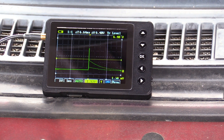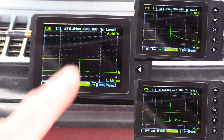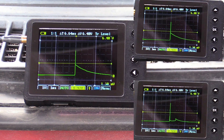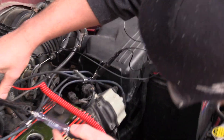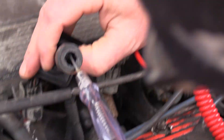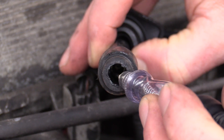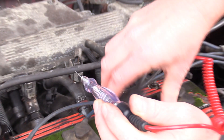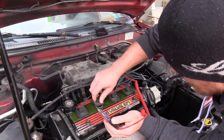Cylinder 2 is the misfiring cylinder - you can see the difference in that line. The firing line has no spark at all, so this one's definitely misfiring. The spark is completely gone, super weak, barely jumping the gap. The electrode is way inside there and it's barely jumping that gap. There's still spark but it's super weak - that's on number two. Number three has strong spark.